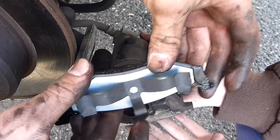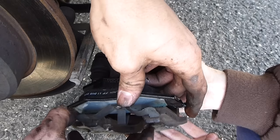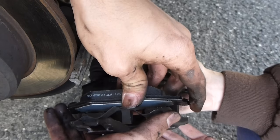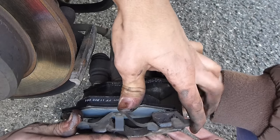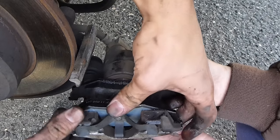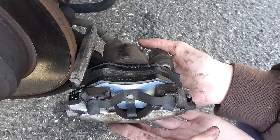Take your brake pad, again with this part of the clip on the bottom, and pull it over — watch your fingers when you do this. It snaps in, snaps in, boom — done. Now these are snapped in tight, everything is lubed, everything is ready to get put back on.